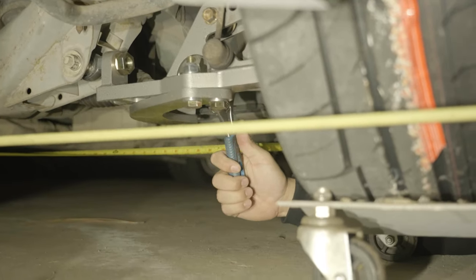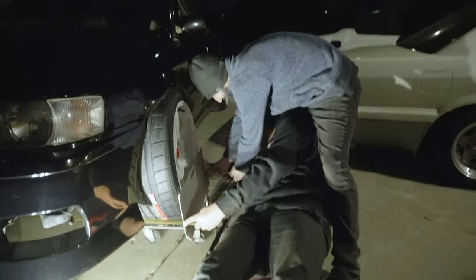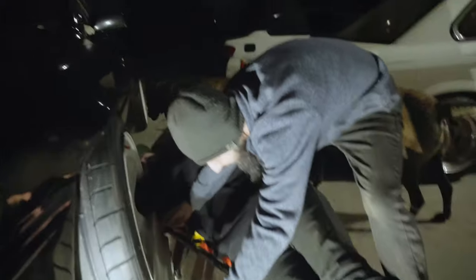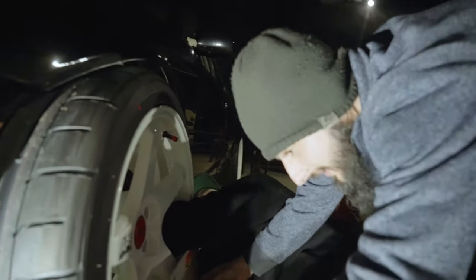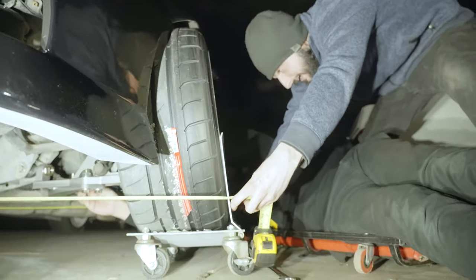You're only adjusting off of this side? Yeah, because this side's towed out. You can see it. Got it loose. I thought you were adjusting. No, that was just me breaking that backside loose. Move your foot. Can you see it? It needs to go in, right? Which means that, or it needs to go out? Needs to toe out? The front, yeah. How's that? A little more. I think that right there.